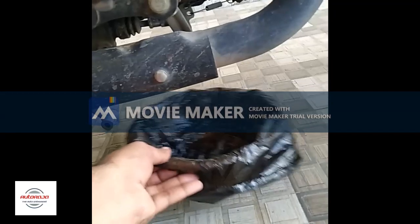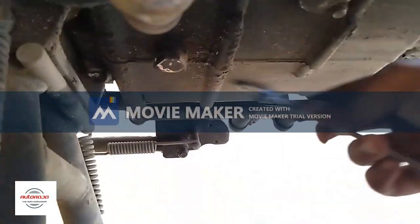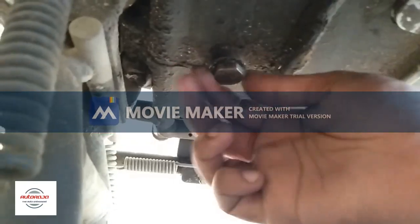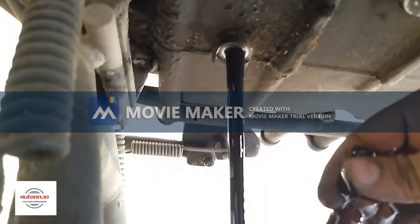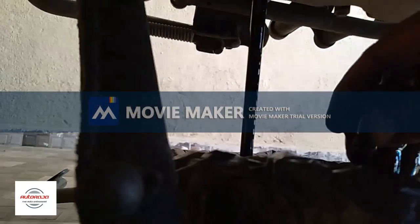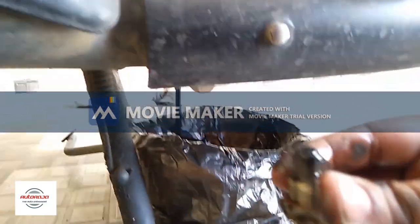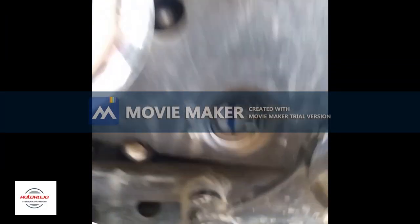I'm just placing it beneath the engine, and here I'm using a 20 mm spanner to remove the drain nut. I just loosened it and I'm just removing it with hand. And as you can see, the engine oil is very black. That means this is actually the right time for you to change the oil. Now you can see the oil gauge, it's completely empty.